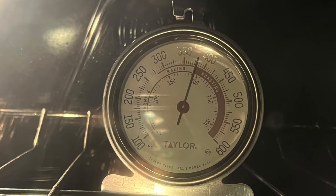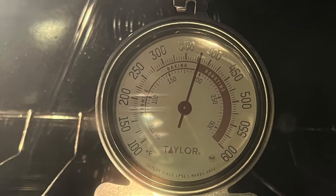After calibration, you can see the oven temperature is pretty accurate. For Samsung oven temperature calibration, the maximum range is 35 degrees, no matter if you go up or go down. If the difference between your set temperature and the actual temperature in the oven is larger than 35 degrees, most likely the oven sensor is bad.